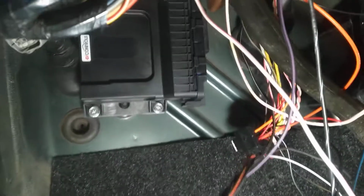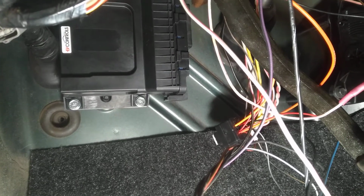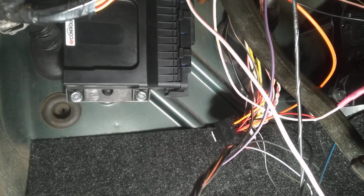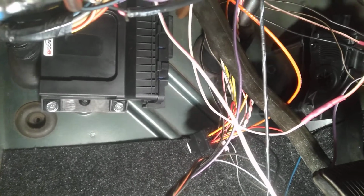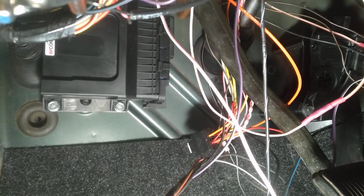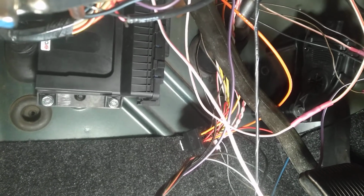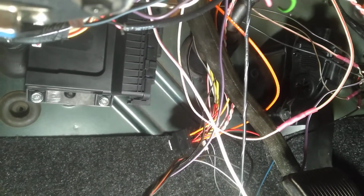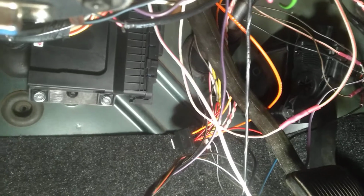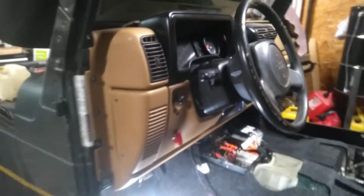But anyway, I had to do some rewiring because this EV controls control board, whenever it sends a command to do something, like to open a contactor, it sends a positive 12-volt signal. Now the StealthEV controller would send a negative. It would send a ground. Sending a ground is much more traditional. That's just generally speaking how all things are controlled. So all the relays in the Jeep fuse block are controlled by a ground signal.